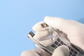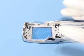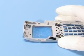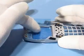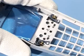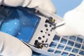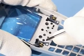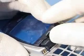Don't remove the screws or twist the hinges, because they fit only in one direction. Protect also the inner part of the window. If you need to remove the function keys, you have to press it at these 2 lockings. Now you can remove function keys.